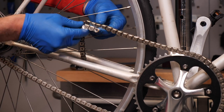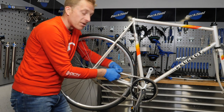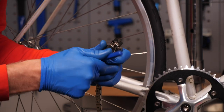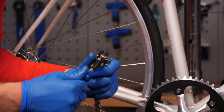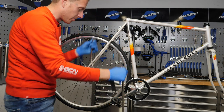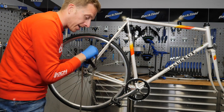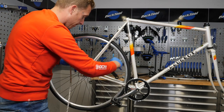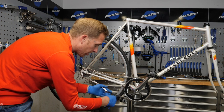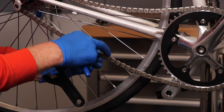So I know it's the fourteenth one there I want to do, and then I can re-join the chain in that position, undo slightly the tension of the nuts here on the rear, and just pull the wheel back in place and get that chain nicely tensioned up. Seems a shame to waste this nice looking chain — big fan of this. Once I had a white BMX chain on my track bike, everyone laughed at me, especially as I fell off really badly that day as well. Right, let's put that joining pin in before snapping it off. Sometimes it might be a little bit easier to actually not do it whilst it's on the chain and sprocket because you might not have that much room to play around with. A handy little tool you could use is a bit of an old coat hanger or something like this.